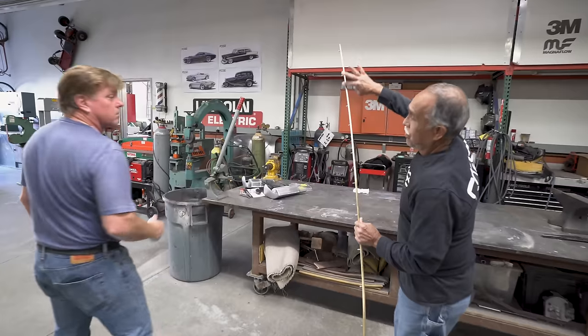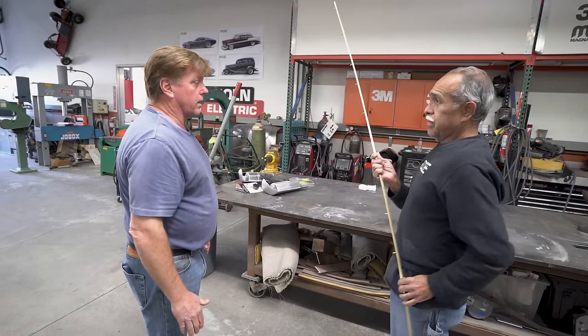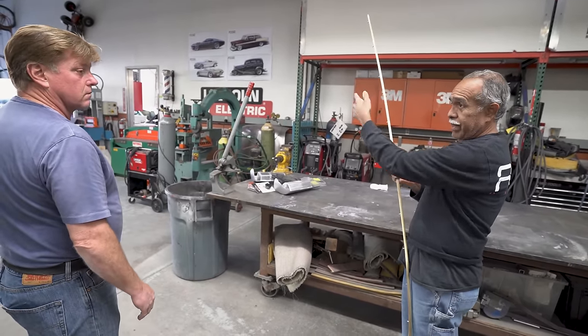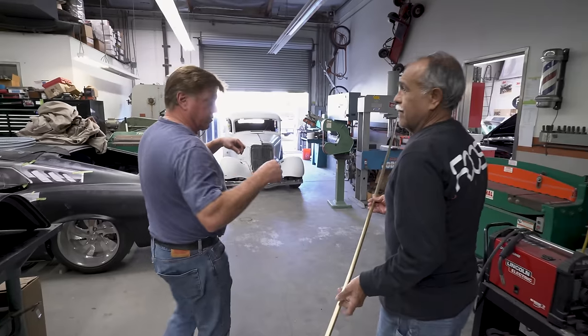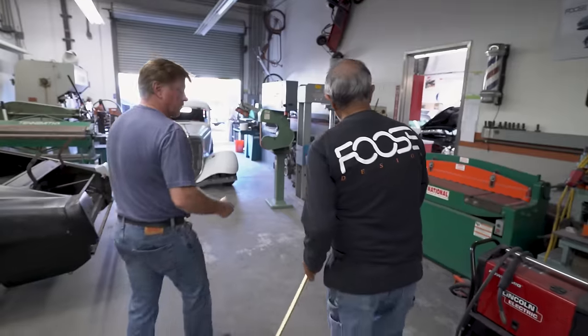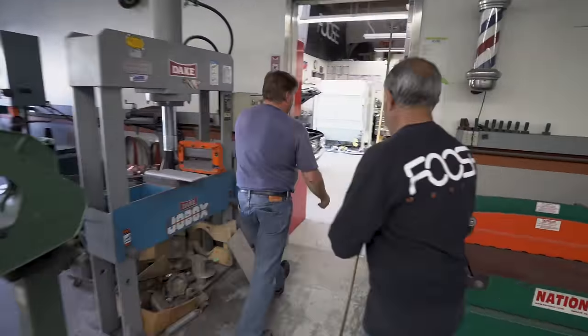And then how would you do the sides? You know, because it does do a little bit too? We'll block those two first, all right. So then I need to leave that side the way it needs to be, and this can mimic that, right? Yeah, afterwards. Yeah, we'll sand these, block them, and we'll probably make a piece of metal to bolt these two. Oh, these two. So we can keep blocking them, yeah. All right, good. And then when Greg coppers them, we'll block the copper until they're straight. So you'll have that fixture already to block the copper.